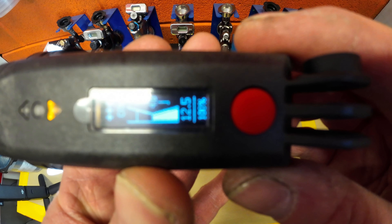We're using our DV1 Gambler Edition base coat gun for the base coat application with the Walcom 360 Truelight attached. Straight away I can see I'm a lot happier using it as the light is concentrated right where it should be and is a help rather than a hindrance. On the early coats of base coat you're not checking coverage as much as your final coat, but it still helps to make sure you're getting an even coat on there. As you get towards the end of your base coat on your second or third coat you can see you've got full coverage and check with the light that you don't need to put any more on.